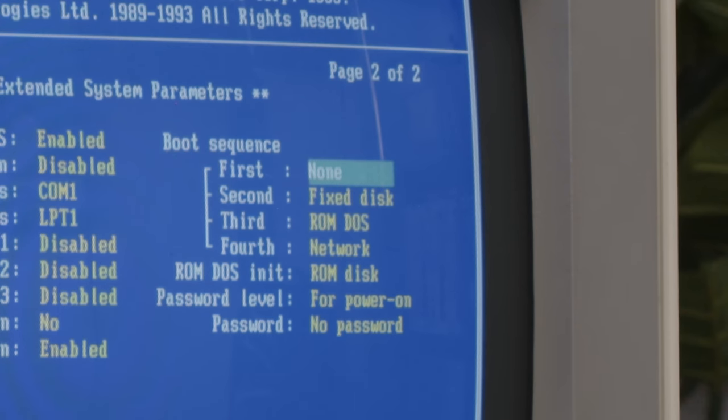After this it just boots up into DOS and it's a completely normal PC. But there is one other interesting feature you can trigger at POST, and that's DOS in ROM. The chips that store the system BIOS also contain a copy of DOS 5.0. The machine can boot from it either as a primary option or a fallback if there's no other bootable medium. The Tandy 1000, the Vendex Head Start, and probably a couple other clones did this, and IBM included it in some of the PS/1 machines. They definitely borrowed a couple other components like the floppy drive and bezel.